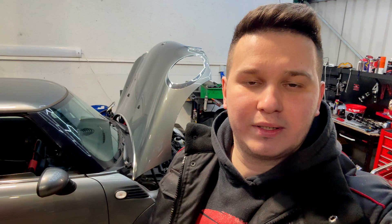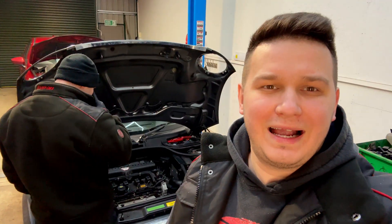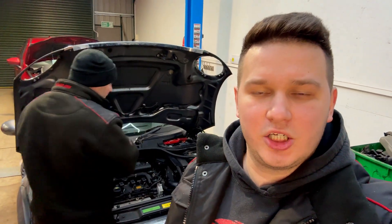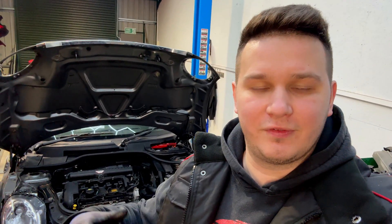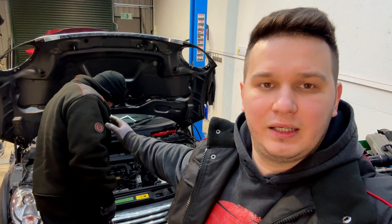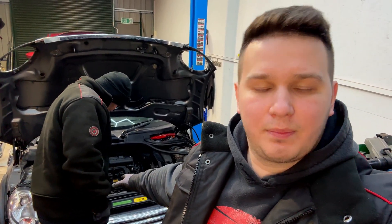Now let me tell you exactly what we are planning to do. For the fact that the engine got overheated, we rather suspect a mechanical issue with the engine rather than an electrical one. You could swap the coils or spark plugs from the misfiring cylinders to the others and see if the fault follows, but we are not going to do that. We are going to skip it, and firstly we are going to do a compression test. Dan is removing the spark plugs and coils.